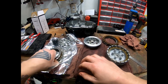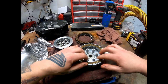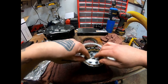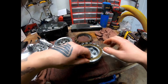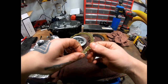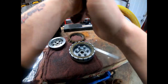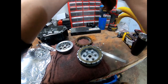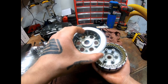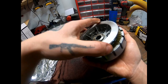So go through all your discs like that — round edge up on friction, round edge down on metal — alternating so the rounded edges always meet. Even if you don't notice any problems right now, I highly suggest taking it apart and checking. I put this clutch pack together, and it was terrible — hard shifting, slipping, bucking violently when I put it in first. I mentioned it to Mike and he immediately said, 'You didn't put the edges facing right.' Took it apart, did it his way, and now it runs like a dream.